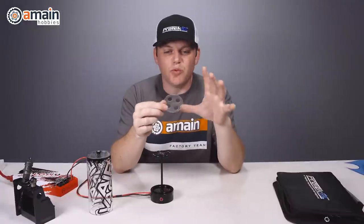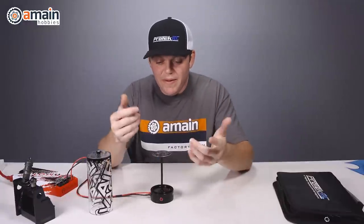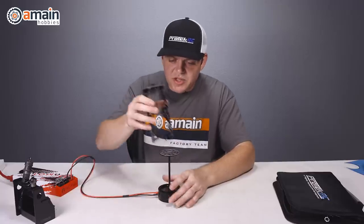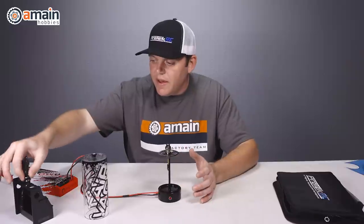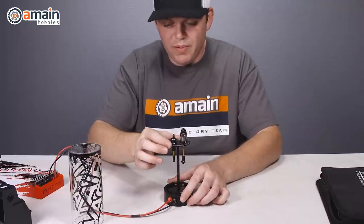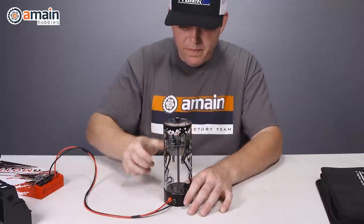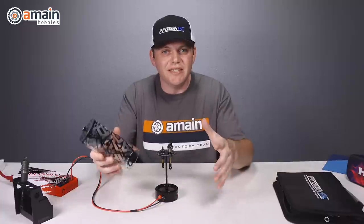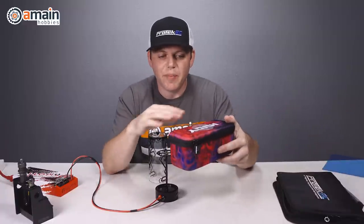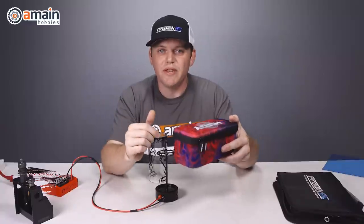The plate is finished — it's just a rough cut, you could always clean it up later with a Dremel. I'm not even going to attach it onto the post with the screw, just set it on top. Here's a 10th scale off-road shock and here is a 10th scale touring car on-road shock — no problem. That's a really easy hack to make one canister size of the Air Vac fit all the different shock sizes. To store this makeshift Lexan adapter, it could just easily go back into the Air Vac packaging for when you need it later.